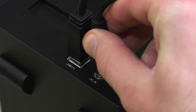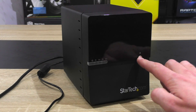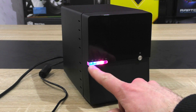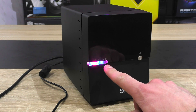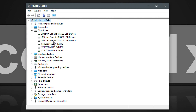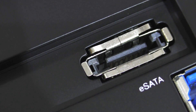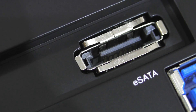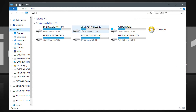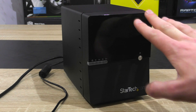Plug the cable in and connect the power adapter to the enclosure, then power it on. On the left of the front panel are LED indicators for power as well as activity LEDs for each of the four drives. Please note: do not disconnect the enclosure from your PC when any of the LEDs are blinking — doing so could lead to data loss. As you can see, all drives are being recognized perfectly in Windows 10 via USB 3.0 with no settings changes needed. When connecting via eSATA, your system must support the SATA port multiplier and AHCI must be enabled in the BIOS. No software or drivers are required. Also note that hot swapping is not supported.